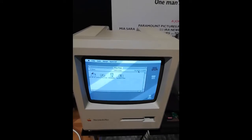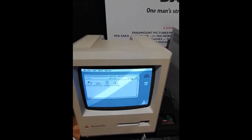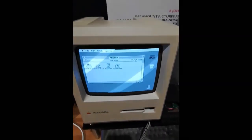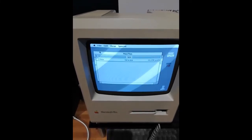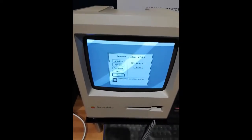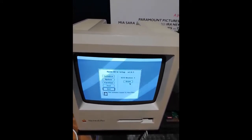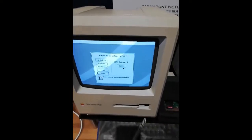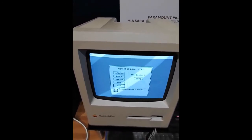I created very small disk volumes because the Mac Plus can be a bit picky about disk size, and you don't really need a lot of disk space anyway. I'll eventually change that and create volumes with more space so I can add larger games and such — this was mainly for testing. Using the Apple HDSC Setup software — the original, not the modded version — I created the volumes as actual Apple disks, so they're recognizable through the software.